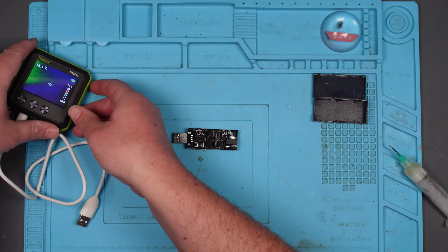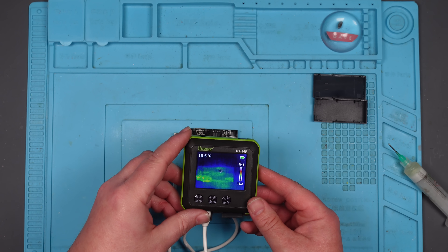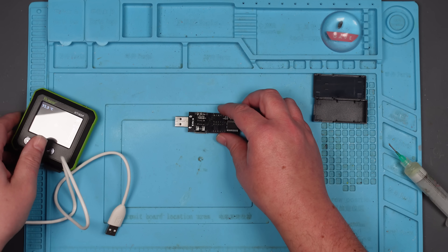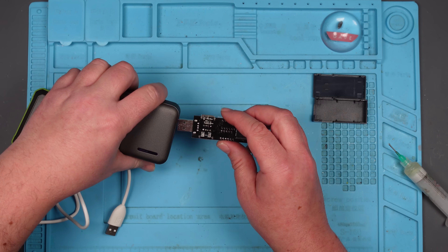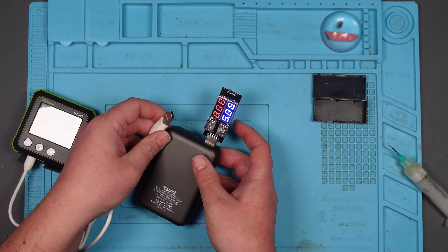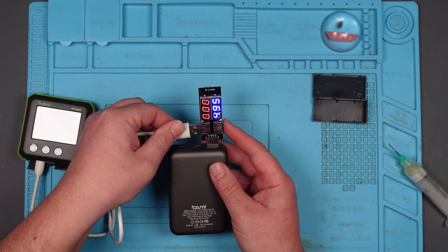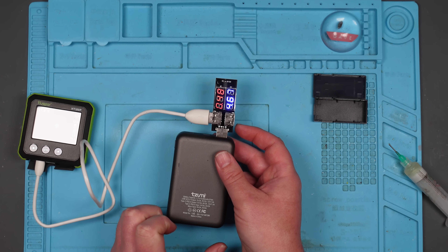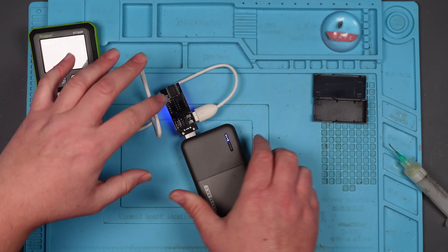Right, I think that will have cooled down sufficiently now — let's have a look. Yeah, there's no heat spots on it — it's about 16 to 17 degrees, so it's less than the 26 degree benchmark that we had. Let's plug this back in. And it still works — bonus. I'm drawing 0.5, 0.48 — same as before. Okay, let's leave that for 10 minutes.